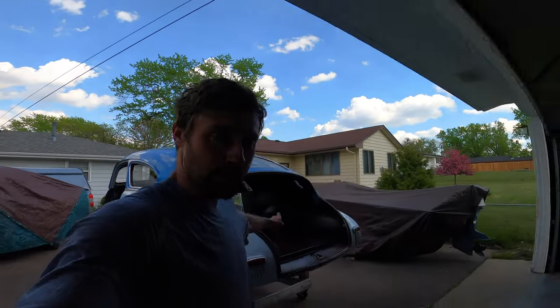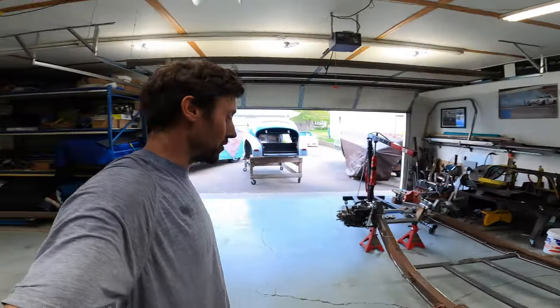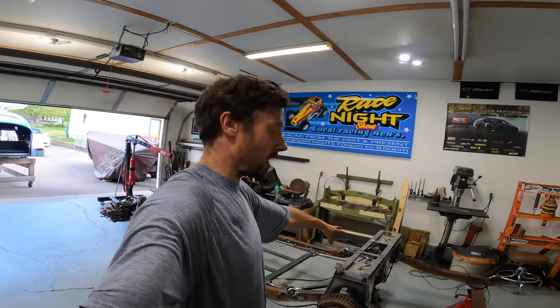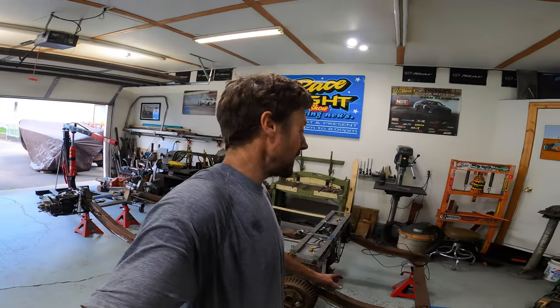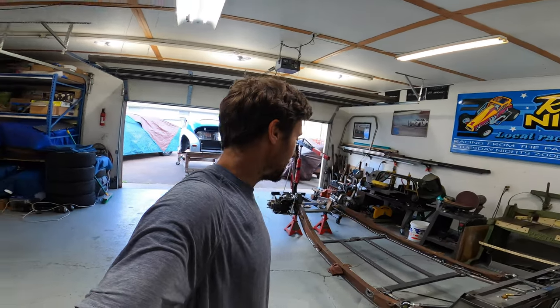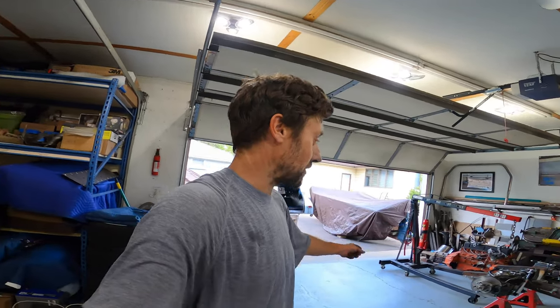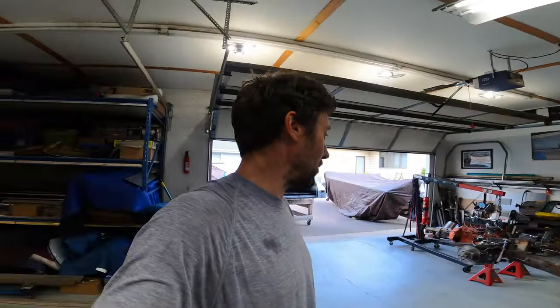Tomorrow — Sunday — I'll finish up the firewall and the driveshaft and trans tunnel, then have some buddies over and put the body back on the frame. Once I do that it's really go time: putting all the air ride components back in and connecting them up to what's already done on the chassis side, putting the wiring harness in, doing finishing touches, getting the gas tank in and the fuel fill line all finalized. Then it'll be time to think about the engine — the oil pan is leaking, there's a crack right near the drain plug and a couple dents in it, so I'm going to pull that, fix the dents, weld the cracks closed, and get some break-in engine oil in there because the engine is a fresh rebuild.